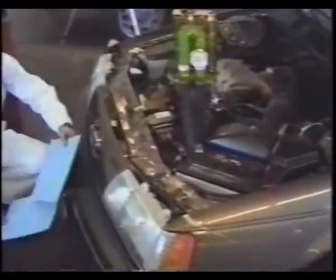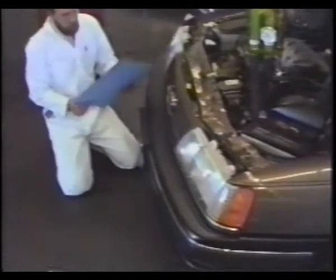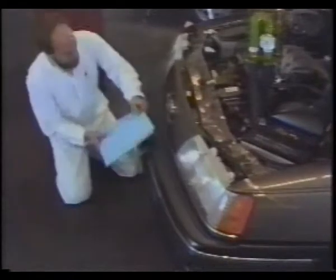Step 5. Place a thin sheet of cardboard directly in front of the radiator. This will speed warm-up and will make testing much more efficient. Best testing results are obtained with temperatures above the thermostat rating. Temperatures of 210 to 220 degrees Fahrenheit usually get good results if the system is pressurizing. Be sure to turn the air conditioning unit off before testing when using cardboard or other airflow obstructions in front of the radiator.